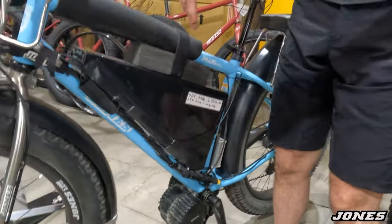This bike has a much bigger, more powerful motor — this one I think goes up to 1,200 watts. So that's a lot of power, and it's an illegal bike on the street as currently set up, because you either have to go below 20 miles an hour with less than 750 watts, or you step beyond that and now you have to be a full motorcycle. I've done some testing on private property only and safe areas — it works pretty nicely. It's fast, smooth, and light, and much faster than I can go on my own.